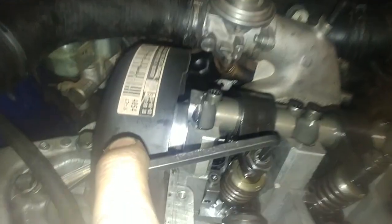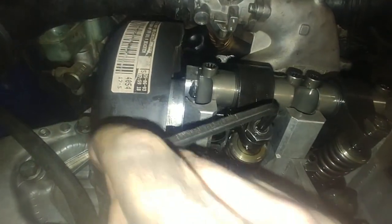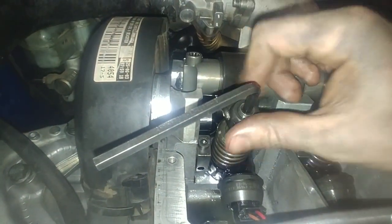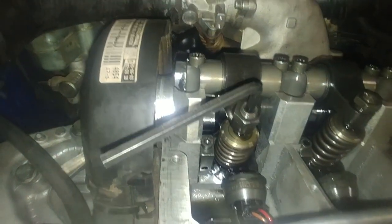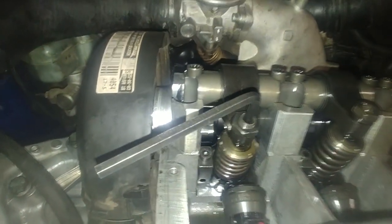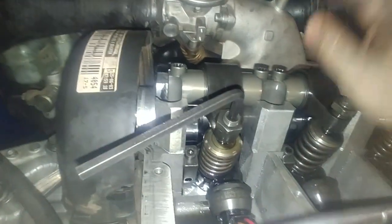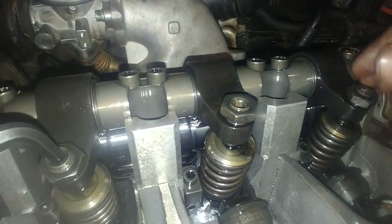You use a dial gauge, but I'm going a little bit past 180 — about there. 270 is about there, so it's more or less in this area here. Then you would take this nut and turn it down. Do check — don't do this just once and then start the car. Do a few cycles and double check it. I've done this about three times, so I know all my settings are correct. You just remove the nut back a bit and then tighten it in.